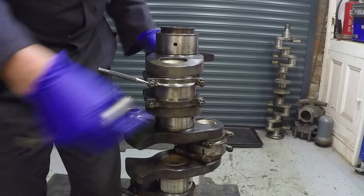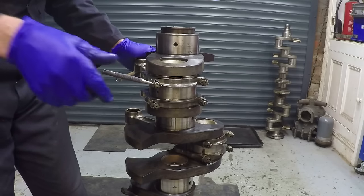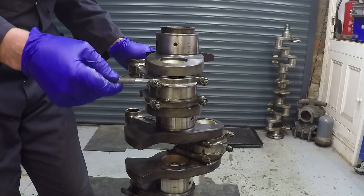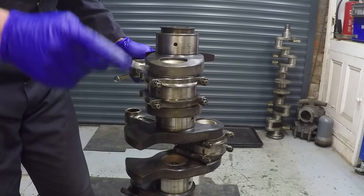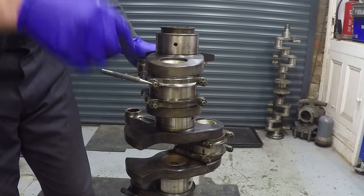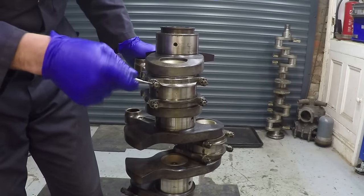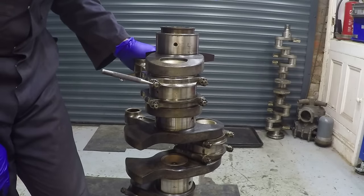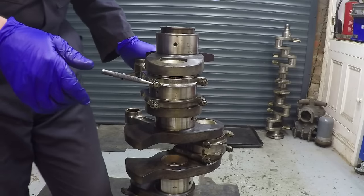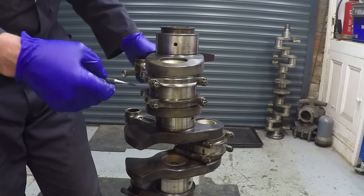If I look at this one - when these bolts were made originally, the split pin hole was here. So every time we stretch the bolts - because these have been reused, which you don't normally tend to do on a modern engine - the hole comes around slightly at an angle. The maximum angle they give you is 22.5 degrees, although actually in 1946 they introduced a note increasing the twist on these bolts to 45 degrees for the same bolt, while the bolts on the blade rod maintain 22.5 degrees.